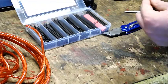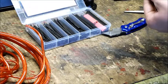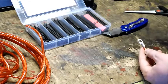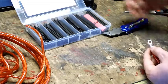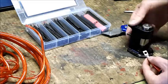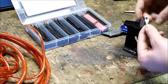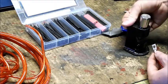You can twist the end of the wire to clean up the strands so they don't catch while inserting the lug. This is really the key part — you can cheap out and just use a pair of pliers and get a crappy job, or you can buy the right tool and get a really nice finished job. This is called a hammer crimp, and why it's called that is because once it's in place, you can smack the top with a hammer to crimp the compression lug.